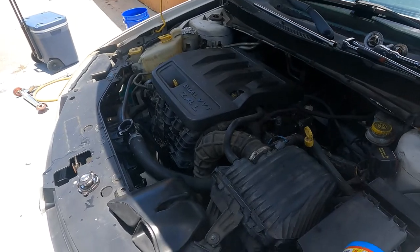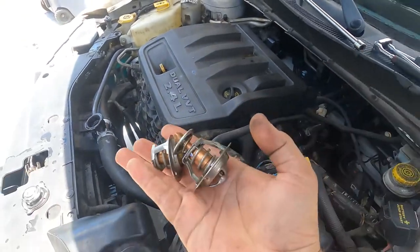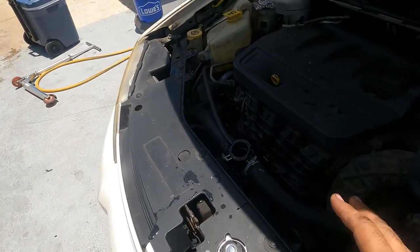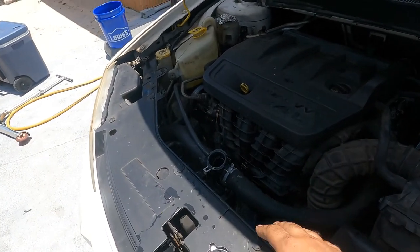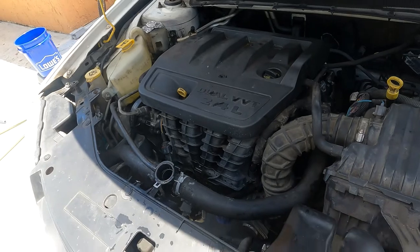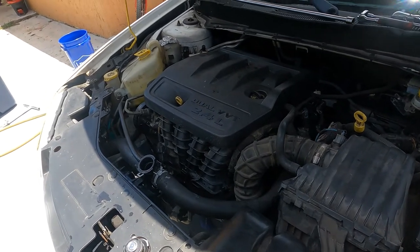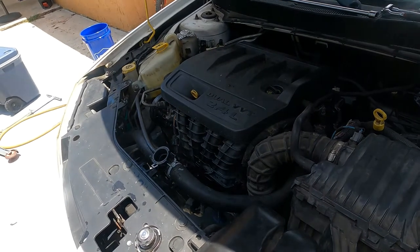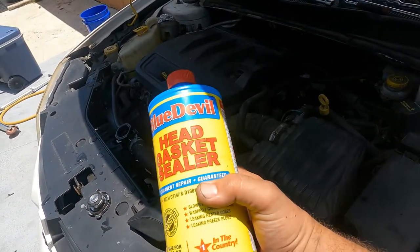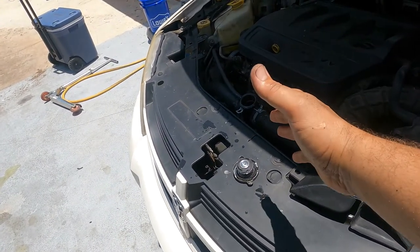At the very least it'll make good video content. So I've already followed the instructions — I removed the thermostats; in this case we have two of them. The radiator was empty because as soon as I put water in it and put the cap on, it immediately got pressure, and as soon as I turned off the car the cylinders and spark plugs got wet with water. I had to drain it again, pull out the spark plugs, and dry them out in order to get the car running again. It's a pretty bad leak in my opinion.